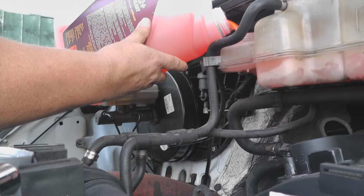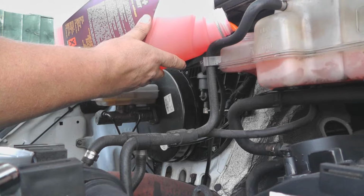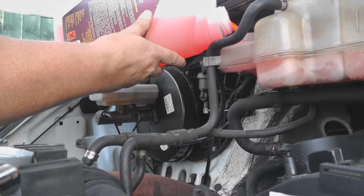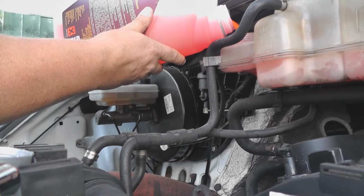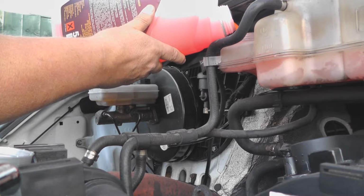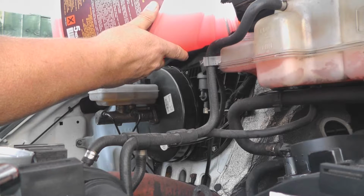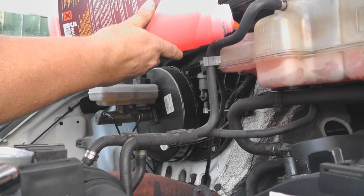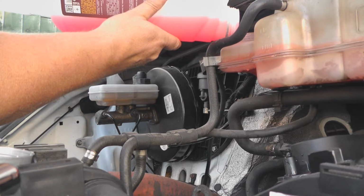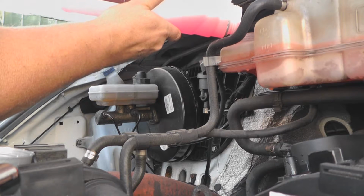New coolant is good because it lubricates the water pump, has additives in it which will clean out the deposits which get building up. This coolant has been in there for 2 years, so ready for a change. As you can see now, it's reaching the minimum and up to the maximum. Well, into the middle now, look.